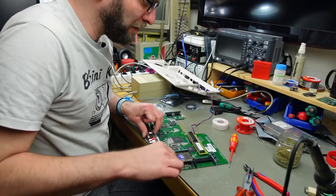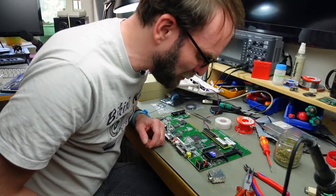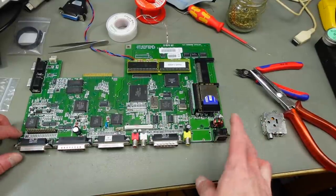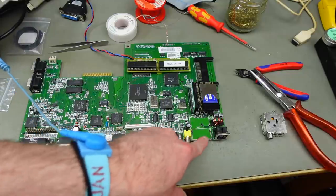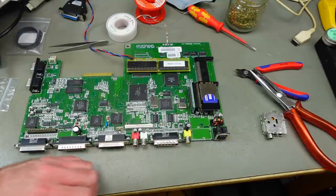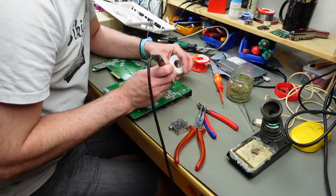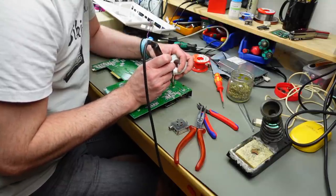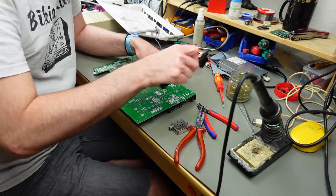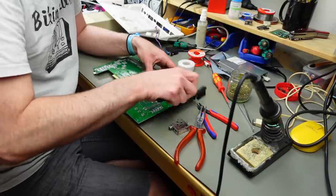Hot air is hot apparently! There we go — that went rather smoothly. We have successfully removed the RF modulator, which is still quite hot because of the hot air, but we got it out in one piece and the PCB didn't get damaged. I'm going to remove the remaining solder from these vias here. We are apparently going to use these to screw down a little mounting plate that Joachim cut from acrylic. This was pretty difficult to desolder because basically it's all ground planes apart from the three little contacts with the board. This Amiga 600 works really well — I'll be doing more videos about gradually upgrading it.